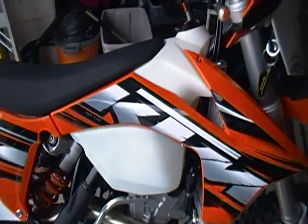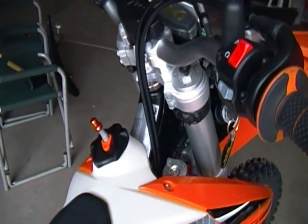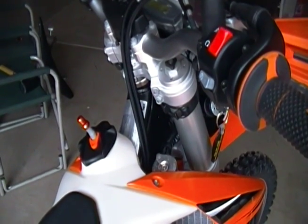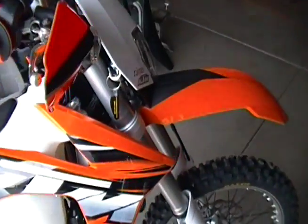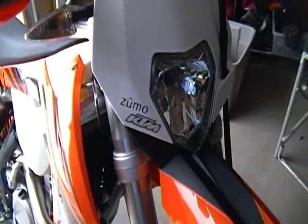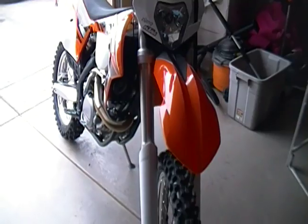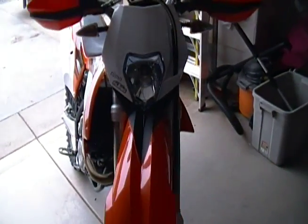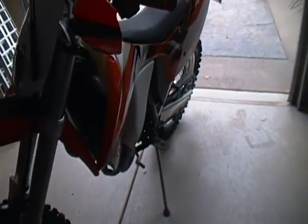There was a special kind of overflow tank hooked up to the gas cap — we got rid of that because I read reports where it could cause some stalling when the bike was in a steep situation where the gas would flow in there and the bike thought it was upside down or something. That's gone. And the air injection, which is a well-meaning but probably a little bit misguided add-on to satisfy the EPA — got rid of that as well.